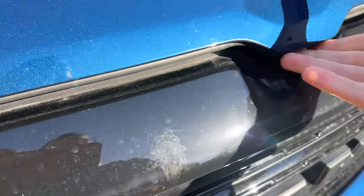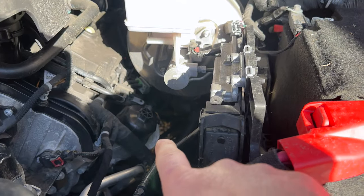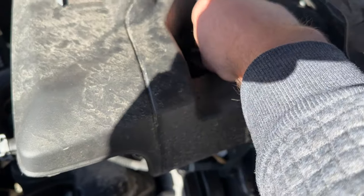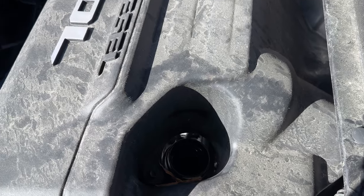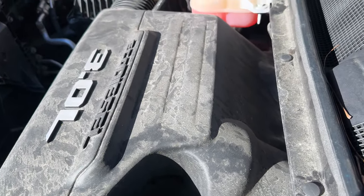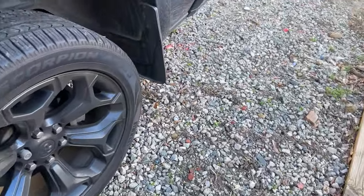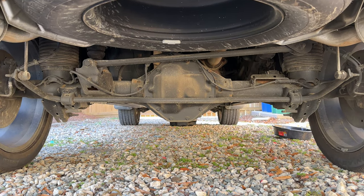Next I'm using the 27mm socket to drain and remove the engine oil filter, then open this up to drain all the oil out. We're also removing this top piece — there are bolts you access in here to get that off, which makes it easier to refill. I've already drained the rear diff as well, so next we'll do the transfer case.